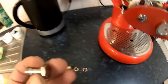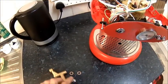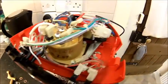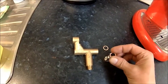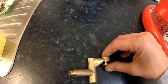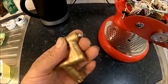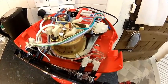Alright, it's the next day and we soaked everything in vinegar and it comes out really shiny. And that was blocked — now it's great. That looks good as well. All the limescale is gone. So that thing goes back to this end here. Basically just gaskets — just use new ones. They don't need to be original spare parts for the machine because they're usually quite expensive. Okay, let me get that back together.